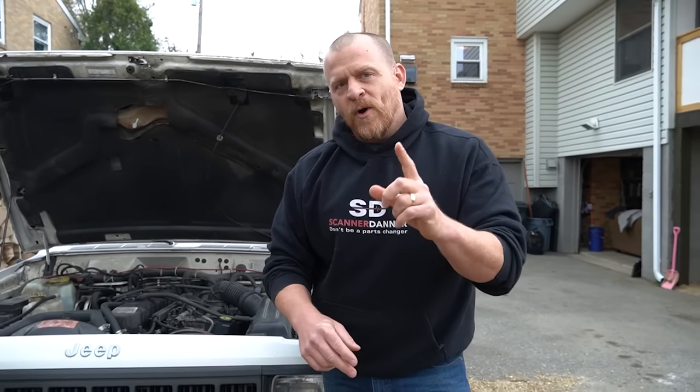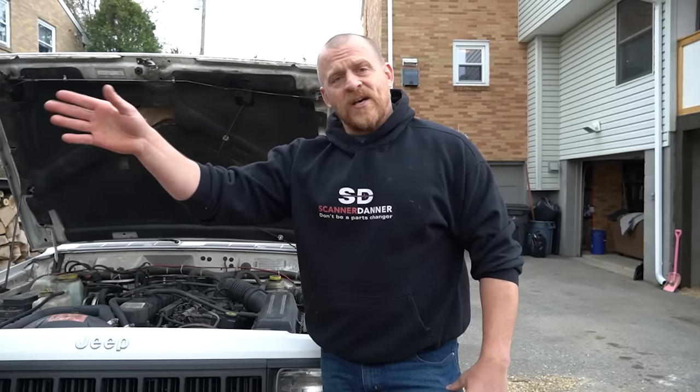The procedures in this video apply to all cars, all years, all makes and models from the dawn of computer systems till 2020. When you're dealing with a shorted reference circuit, computer powers and grounds, the procedures I showed all apply. Yes, we did attack this problem incorrectly — we should have started with fuses. The reason I did not is I was teaching a class and felt it was important to include the five volt reference shorted testing, because that's the one nobody knows. Everyone knows how to check a fuse. When the fuses are good and you have no five volt reference, you do exactly what I showed as far as isolating the circuit.